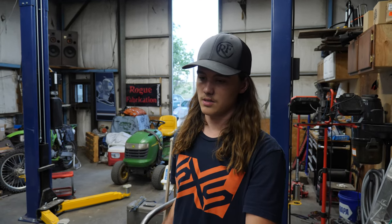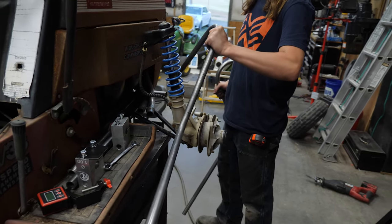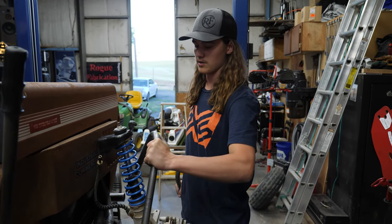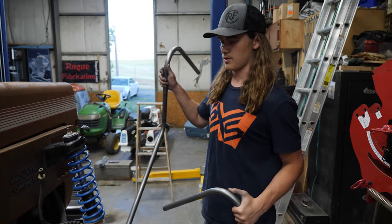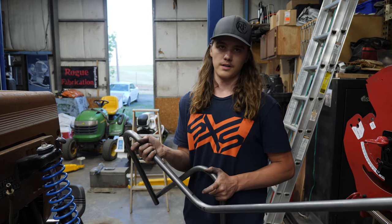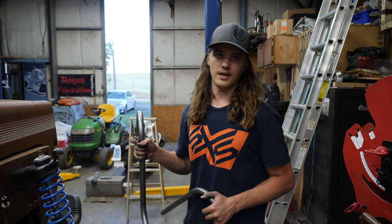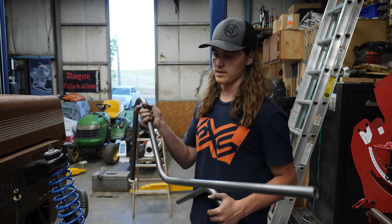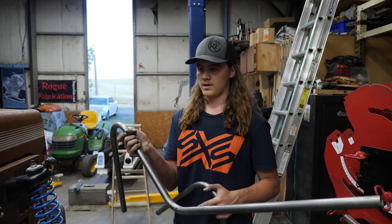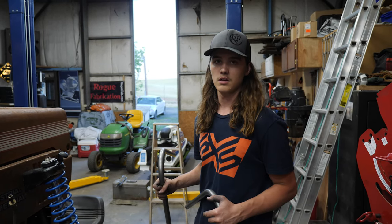So we got this side bent now. I didn't screw it up, and I changed the angle of rotation between the two bends by about 5 degrees, and I like it a lot better. So I'm gonna go ahead and redo the other side. I could just cut this, rotate it 5 degrees, and seam it up, but instead I'm gonna bend another one, and then I'll use this as a mock-up angle, so I have an idea of what angle I might need to bend something before I do. It'll work good for that anyway.